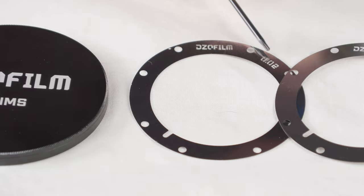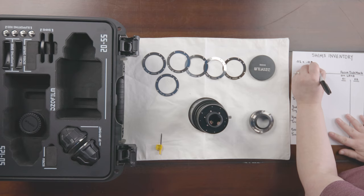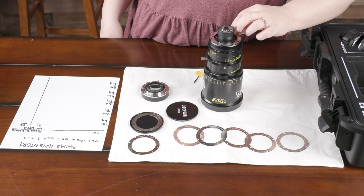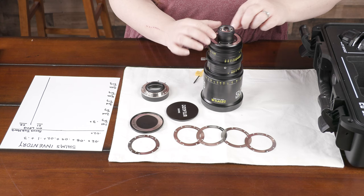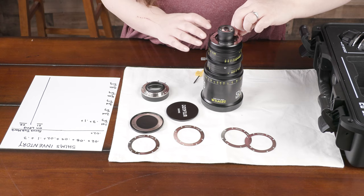Take a quick inventory of the shims and write down what individual shims you have on hand. The lenses also come with several shims already on them — take these preloaded shims off of the lens and add them to your inventory list. Once all the shims are removed and you have written down your inventory, you are going to start. Your lens has no shims on it, so go ahead and decide how many shims you want to put on the lens for your first try. Just choose a number — maybe four shims, a couple of 0.1, a 0.02, and a 0.05. They're all different thicknesses, so take notes as to how many shims and what thickness you add or remove each time. Once you've added some shims, go ahead and screw the lens back together and put the lens on your camera.